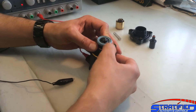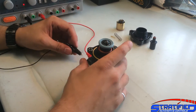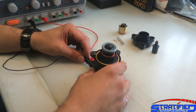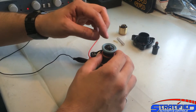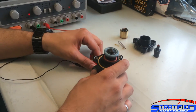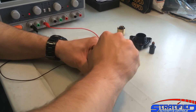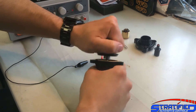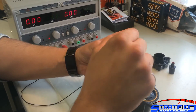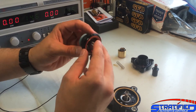When you lift off, this thing has to release - it's electronically actuated via a solenoid. It lifts, expelling the extra boost from inside the diaphragm into the low pressure zone, then returns by the return spring. Once the diaphragms fail, they obviously leak boost and can no longer hold it, because holding boost depends on being able to build pressure in the back end of the valve.